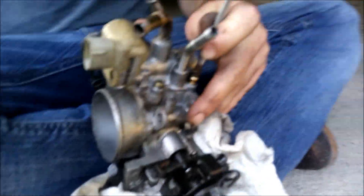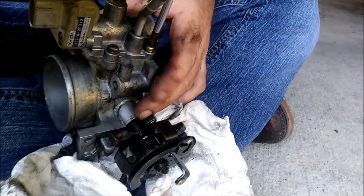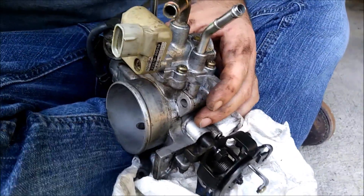Make sure your rubber gasket is in place because these gaskets you cannot find at the auto parts store — only on eBay. They'll sell you the idle air control valve for two hundred-something bucks as some knockoff Chinese brand, but you will not get this gasket separately. Try not to pinch your gasket. Put two screws in across from each other and tighten them in while checking the rubber, then put the last screw in. Tighten all screws in a crisscross formation.